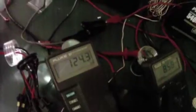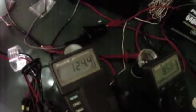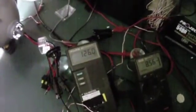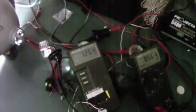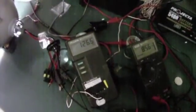That's still climbing, which shows you that a 100-watt HID is putting out the same amount of heat as a 100-watt halogen, except it's putting out around about five to six times the amount of light for that same current draw and same temperature — so the efficiency of HID is up quite a bit. Now, everyone states that HIDs run cooler than halogens — that's not entirely true. What it means is a 100-watt HID outputs the same as a 600 to 700-watt lamp, so it runs cooler than a 600-watt equivalent.